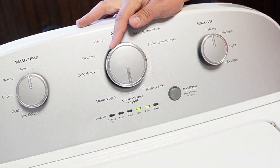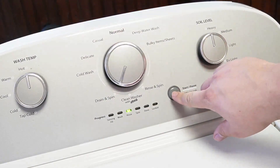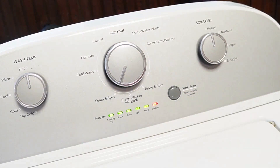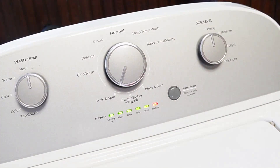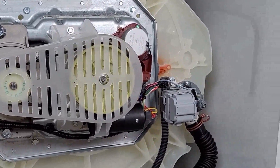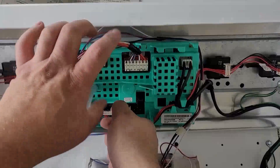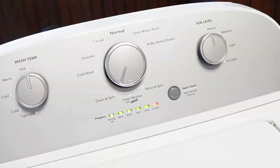Once you're in this mode, turn the knob clockwise four times. The rinse light should be the only one illuminated solidly — this is the recalibration mode. Once you press the start button, the door lid will lock and it will begin a series of tests and operations on your washing machine, taking approximately three minutes. Every part and process on this washing machine is going to be run and the machine will physically reset all the components to a default state, allowing them to run at an optimal level. When the calibration mode ends, every single light will turn off including the lid lock light, and the machine is now ready and recalibrated.